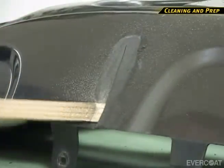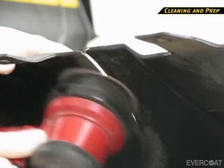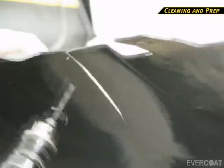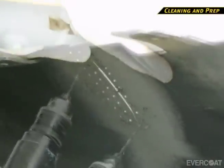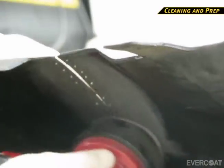After reaching the desired look and contour on the front, sand the back side of the bumper with 80 grit. When the damage goes to the edge of the bumper cover, create a soft taper on the edge to allow room for the adhesive material. To ensure maximum repair strength on an edge or in a high stress area, drill both sides with a one-eighth inch drill bit. This process, called pinning, creates a rivet effect with Multi-Fix on both sides of the repair. If there is any loose plastic remaining after the drilling, simply sand the area with 80 grit to remove the loose material.